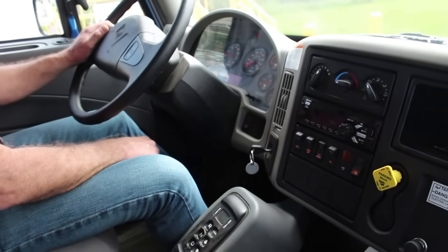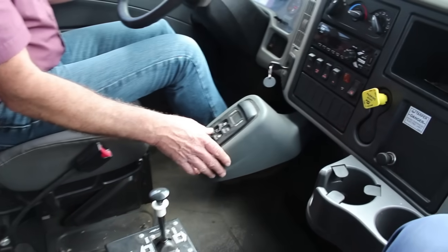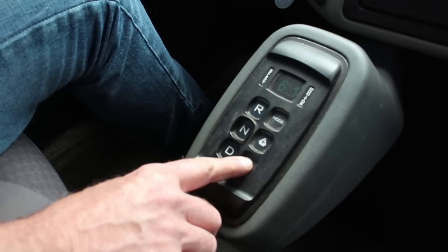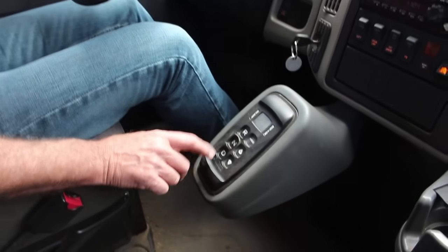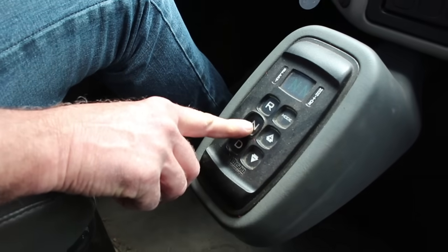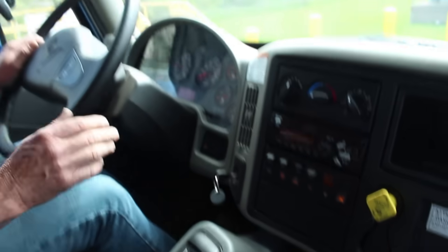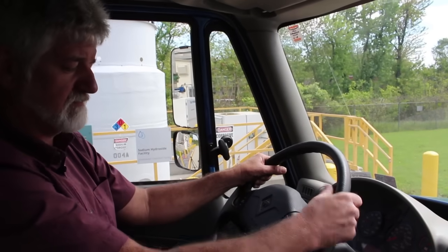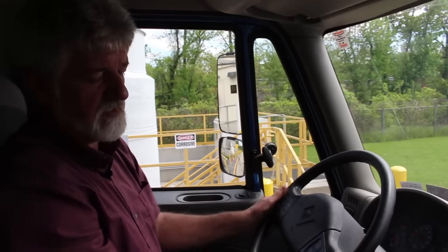I will now perform the tug test. The emergency brake is applied. I put the truck in drive, select a lower gear, and lightly accelerate to make sure that the truck doesn't move. That's the tug test. Next, I'm back in neutral — I'll release the air brakes and pull forward between five and seven miles an hour to make sure the truck doesn't pull from side to side and the brakes don't pull or drag. Everything feels good.